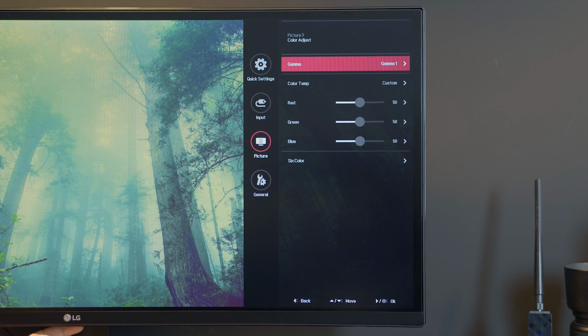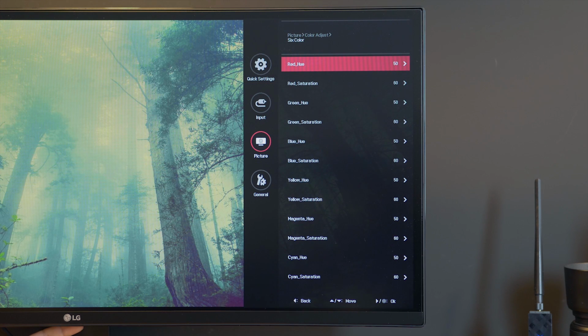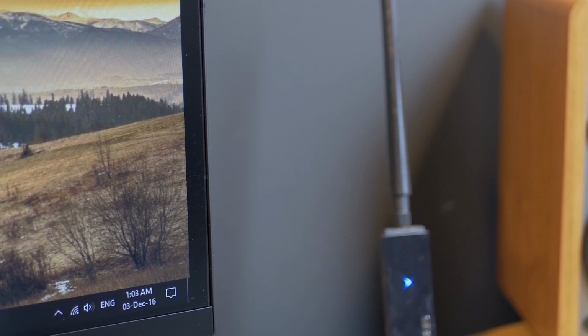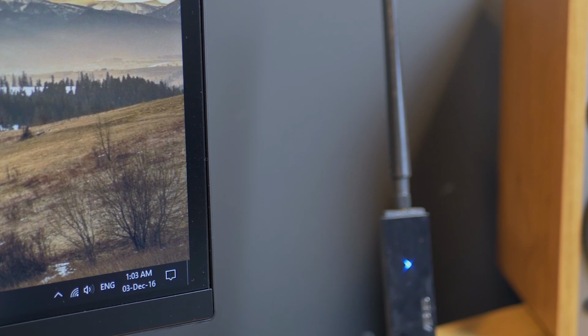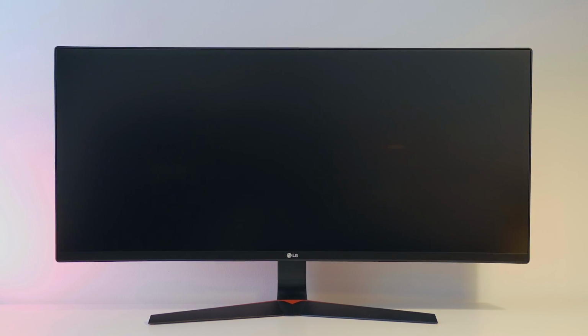This is partly remedied by playing with other monitor settings like gamma and contrast, and in software with the display drivers. But it's a palliative measure, not something that completely removes the darkening. At 120Hz it's less noticeable though, and I don't hold this against the monitor, as I know there are technical limitations at the moment, especially for high refresh rate IPS panels that only recently have started to appear.